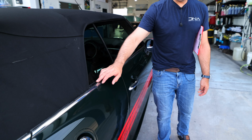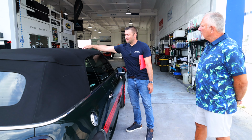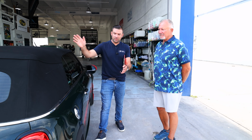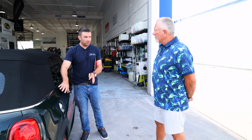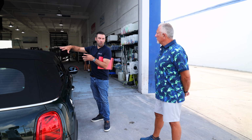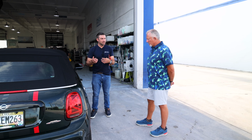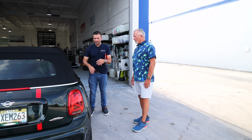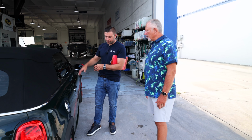So we're gonna take care of all this, and anything, kind of when we open this top up, this is all game in here. Oh, okay. Yeah, wow. You got a seal in here. So you know, believe it or not, when the boot comes up over this, you've got pieces in there. So whether we're using the hard coatings or we're using the Regenix, the water-based product, we're basically trying to touch all the weather stripping and seals that are in there, and even any of the mechanical workings. That's kind of the nice part about the water base. We can just spray it anywhere, let it dry. You don't have to worry about it curing onto the paint. So everything's done. So we got that buttoned up.